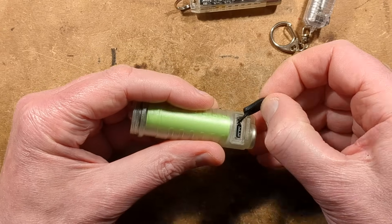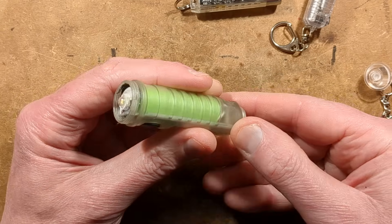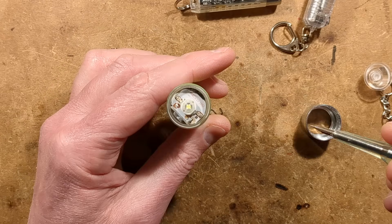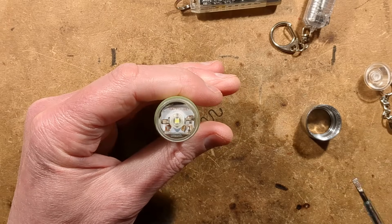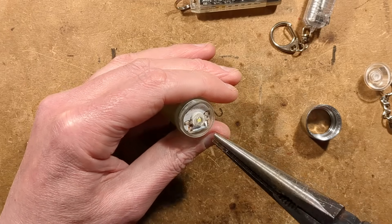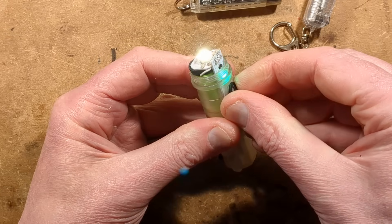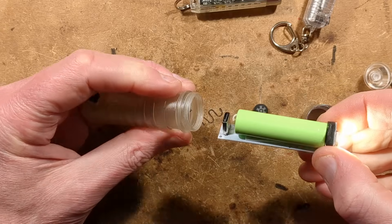There is incidentally a USB-C charging port at the back. To get the circuit board out — I'm just going to gently shove it from that connector. There's a rubbery seal here that might be being used to jam it in. If I grab it with long-nose pliers — this is where I break mine, but it's better I break mine than you break yours — I'm going to grab the main circuit board and pull. I found that just ripping the rubber button out of these things usually helps, and here it comes.